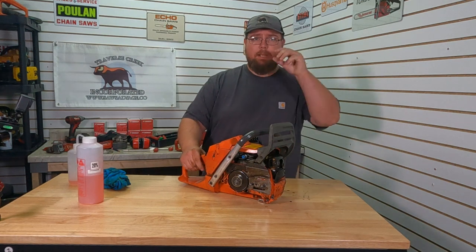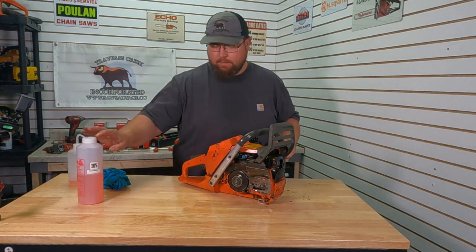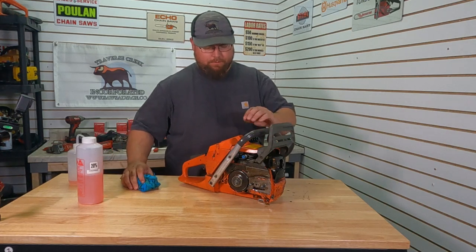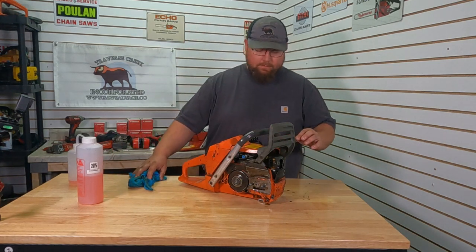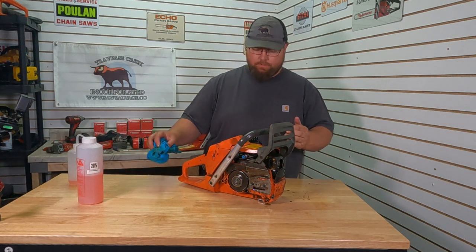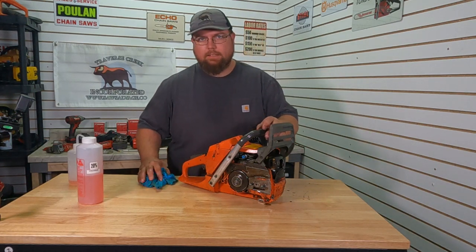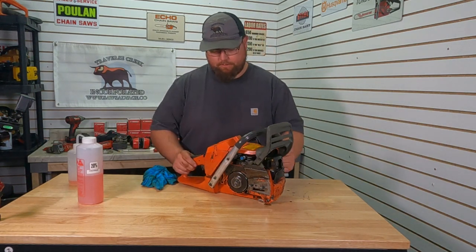There, we got back to the gasoline. That's how much more fuel has to be running with the alcohol nitro than regular gasoline. I said we were on the lean side almost with the nitro fuel, and it was that much more than the gasoline could support that it just drowned it out.